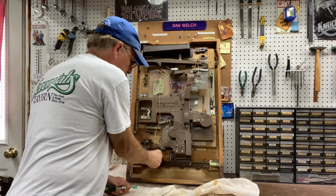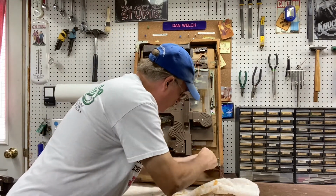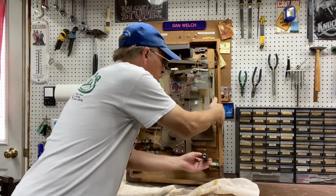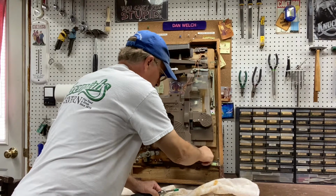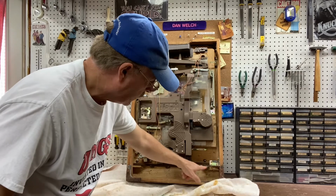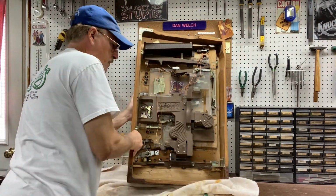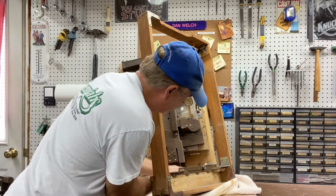So there's one here. And this is usually one of the first things I take off as I'm starting to strip a machine, is the lower feed tray, because once it's out of the frame, then it becomes an encumbrance for you. So there's 2 of the nuts. Now on this one, there's the anti-theft piece of plastic across here that's kept people from sliding stuff up inside and trying to beat the machine. So you've got to open this up to get at the 3rd nut that's down here.